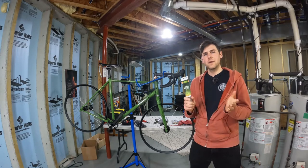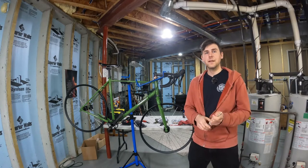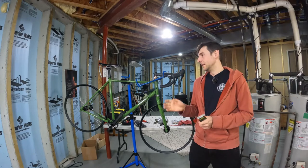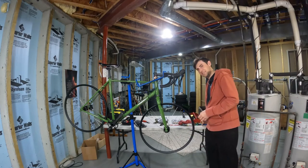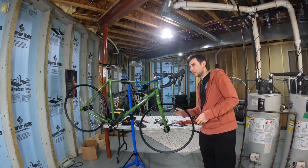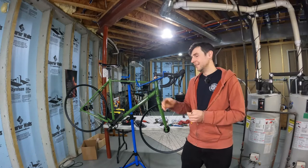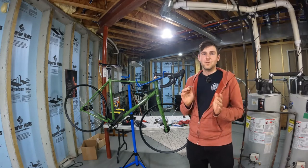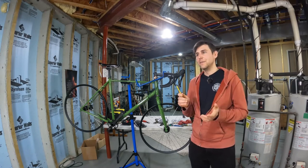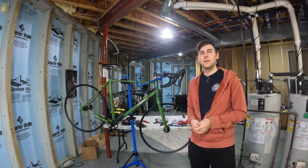There's also aluminum anti-seize, and I always thought that was the same thing — but when I was researching, I found that aluminum anti-seize has aluminum in it and apparently you can't use that to protect aluminum, which is kind of logical. So you should probably use the copper stuff. Let me go ahead and get the seat post out with a four-millimeter allen key and then put some anti-seize on the seat post. I don't know if it's best to put it on the seat post or inside the seat tube — another thing where you get really opinionated people on forums online.